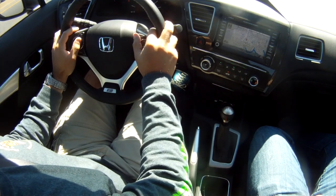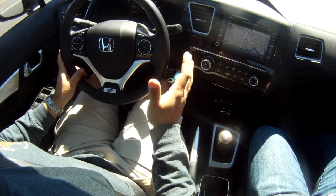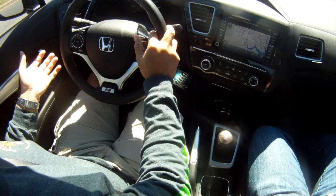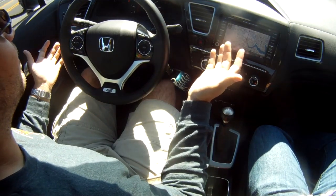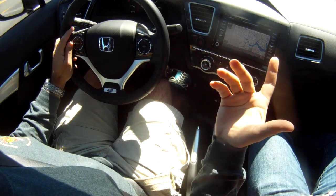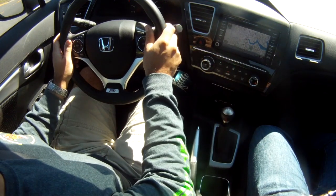I'm going to show you what is not a heel and toe. Just to give you an idea — let's say you're cruising along and you want to go to a lower gear. The lower RPM you're in, the less this is going to matter, but let's say you get up to some RPMs and drop it into a lower gear. Look what happened — the car jerks, the RPMs jerk, and that's bad for everything. It's bad for upsetting the car and bad for yanking the motor to a higher RPM. Now let's say I want to do the same thing without the brake: I put the clutch in, I blip it — and look how amazingly smooth that was. The RPMs are right where they need to be, the car is decelerating on its own through engine braking, and everything is smooth.